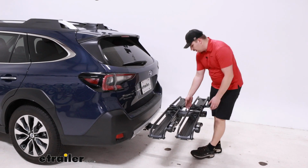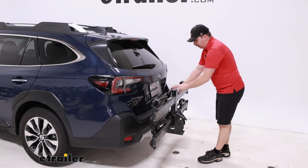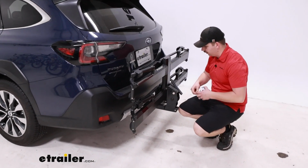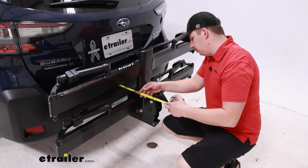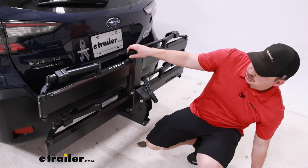and if we want to save some extra space between rides, leave it in the hitch, we can just fold it up. Using that same pedal that we did before, it'll fold upright like that and cut down on the space we're adding to the back of our vehicle by quite a bit. It now only sticks out about 12.5 inches, making this a very compact shape.